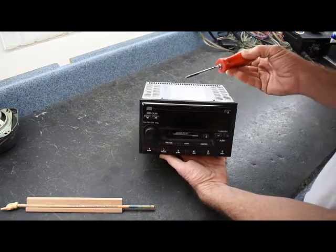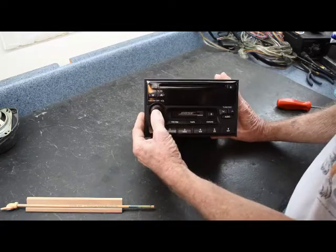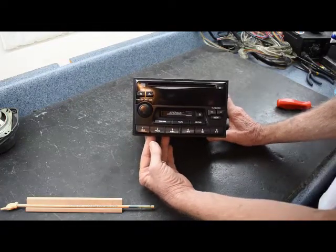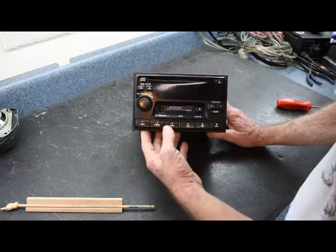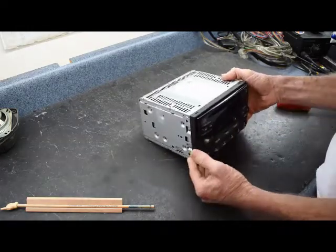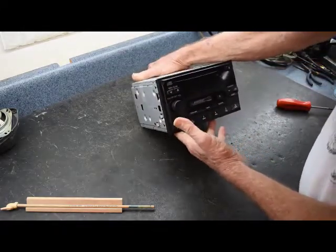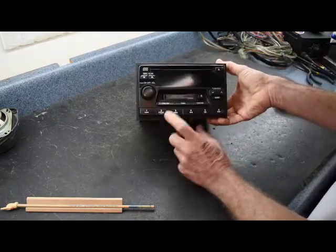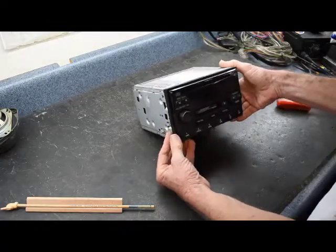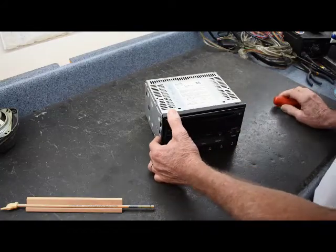You are going to need a small Phillips screwdriver. For the no power problem with the radio not turning on at all, this could be a fuse problem. There are several fuses depending on the model. This particular radio is a PN-2261. Our website, Car Stereo Removal, if you follow it through to your year and model car, will show you wire diagrams. Usually a no power problem is one of possibly three fuses depending on your system. This is the Bose system, although it is a Clarion-manufactured radio. Check the fuses in the car — there is one in the regular fuse box usually labeled radio, and one under the hood labeled backup.